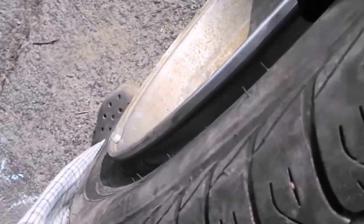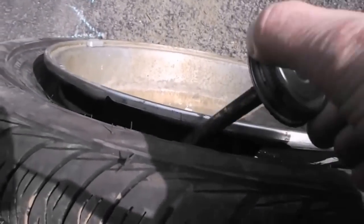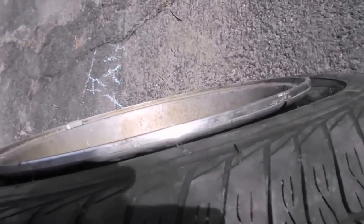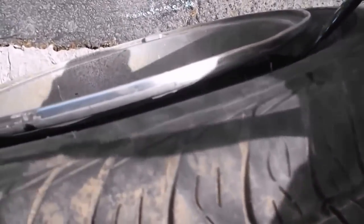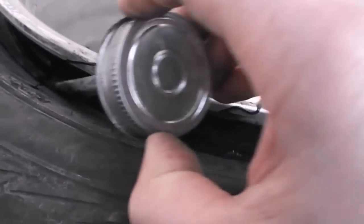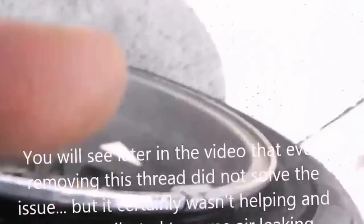It looks to be pretty messy stuff. I don't think I need a lot, and you don't want to get it on your clothes. You want to put a little bit on the rim and some on the tire. This will not only help the bead seal, it will help the bead seat — so when you go to put air in, it will be a lot easier. I actually think I see where the problem is right there — there's a little bulb of rubber all along that rim. Maybe during manufacturing there was some problem there; that could be part of the reason too.